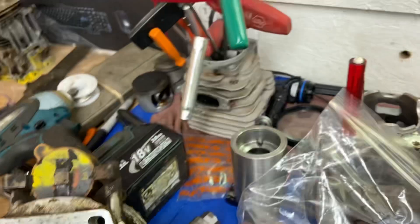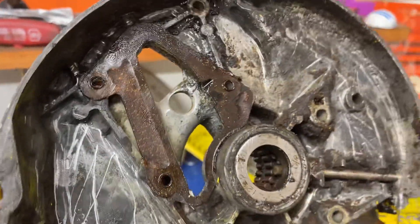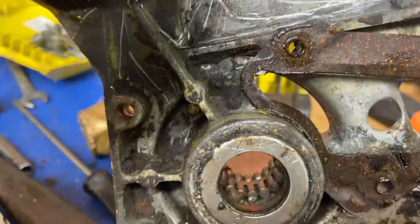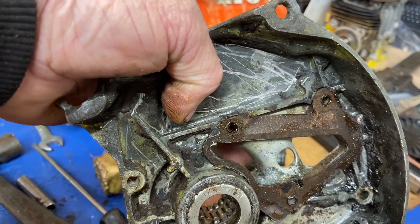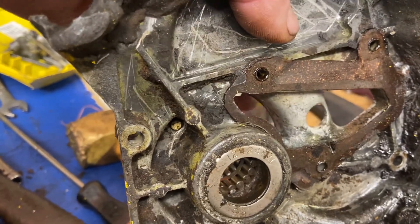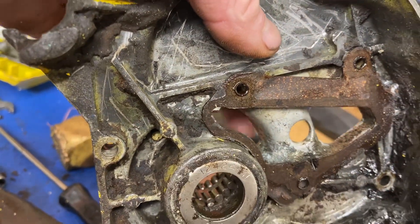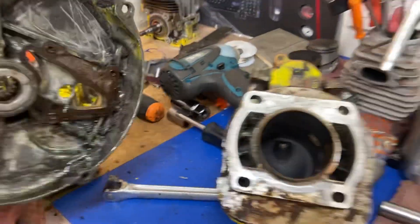If I'm going to put this back together and get it going, I'm going to need a little bit of help, so I'm going to go see Bobby Walker — my dad. There's your intake right there — as the disc is turning around, where my finger is moving, that's where the fuel is going in, coming out of the carb and into the rotor valve, and as it turns around it gets its fuel. Pretty cool.